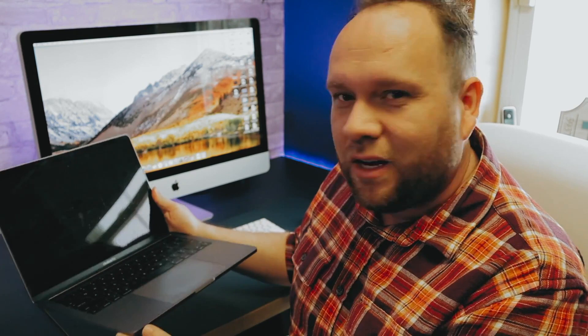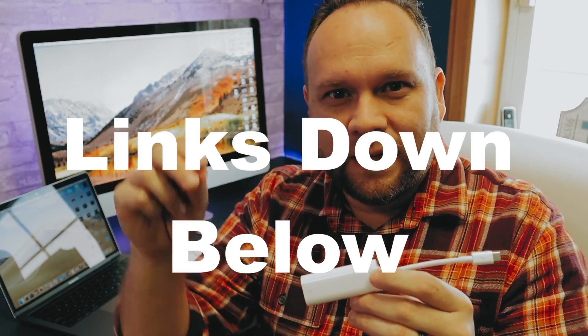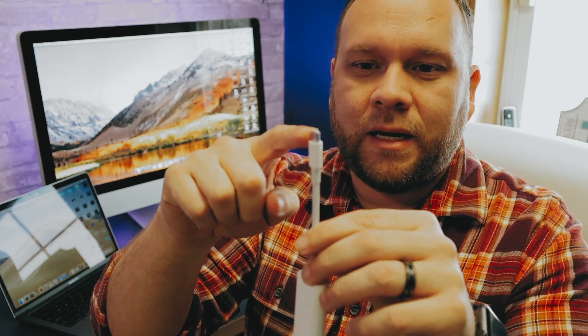I'm using a 13-inch newer MacBook Pro here — I think it's 2017 — but they make these now with just the USB-C ports, so you've got to live that dongle life. Apple's made it a little more difficult now that they only have the USB-C inputs and don't have those old HDMI inputs like on their older MacBook Pros. So in order to do this, you need an adapter. What you'll need is a Thunderbolt 3 to Thunderbolt 2 adapter — on one end it's a USB-C, on the other end it's the DisplayPort Thunderbolt. I'll have a link in the description below where you can get this. You'll also need a Thunderbolt cable. I went with the 0.5 meter cable since I don't like a lot of wires on my desk setup. Those are the two components you'll need.